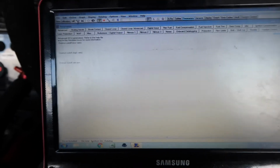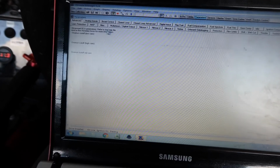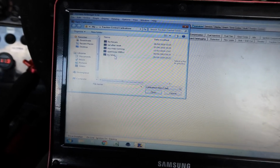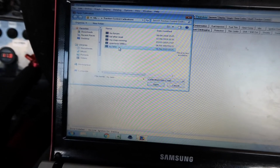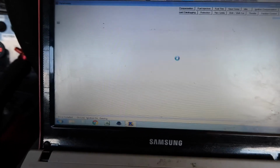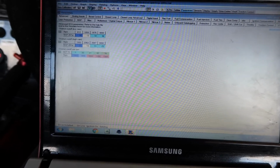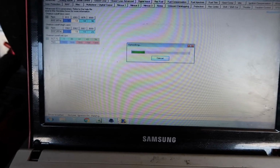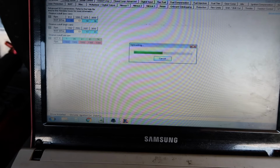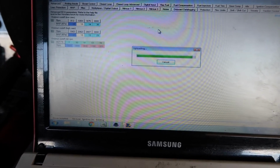No, actually, I think I need to upload a tune to it. Let's try that first. File, open. We'll go for open loop, 1000cc, and we need to upload that to the ECU. Nice and quick. It's a full map as well.